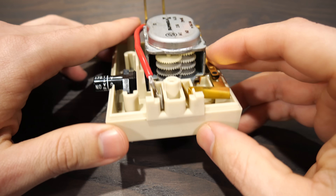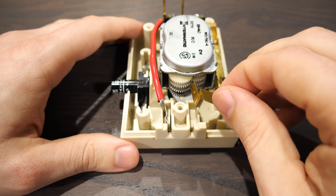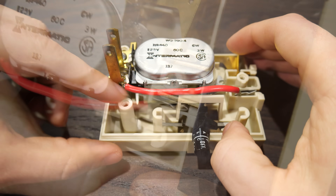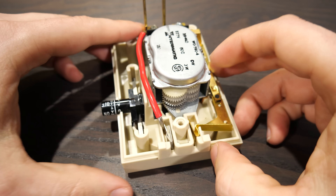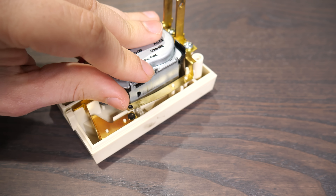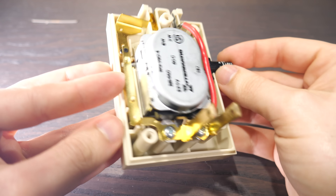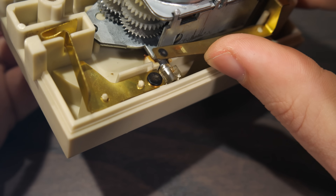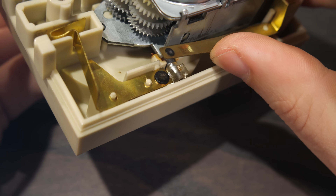Here's where the actual switching and the timing of that comes into play. Let's talk about the electrical switch that makes this thing useful. In this timer, it's almost hilariously crude. Incoming power from the blades runs right to the terminals of the outgoing receptacle — and those terminals have bumps on them which actually engage with the holes in a plug! One blade has a simple wire link attaching it directly to incoming power, and the other runs through two formed pieces of brass that touch through a contact right here. The pokey-outy knob of the power switch attaches to a shaft running through the timer body, on the other end of which is a simple rectangular bit of plastic which either pushes the contacts apart or lets them touch. A simple 90-degree turn of that shaft is all that's needed to change switch states.